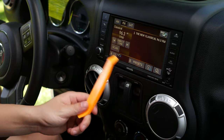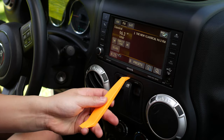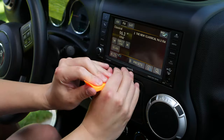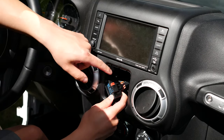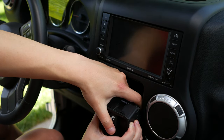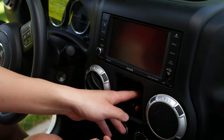The first step is to get your plastic panel removal tool, or if you don't have that, a flathead screwdriver, and dig it into the top of your window control in order to pop it out. There's going to be a cable connected to the back of it. Pull on the red tab to release the cable, then pull the cable out — it's fairly difficult if it's your first time because you don't have a lot of space in there.